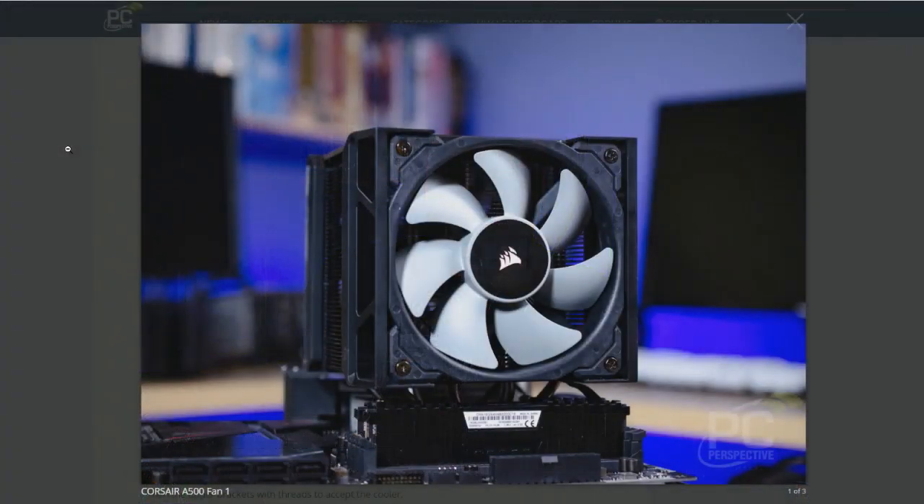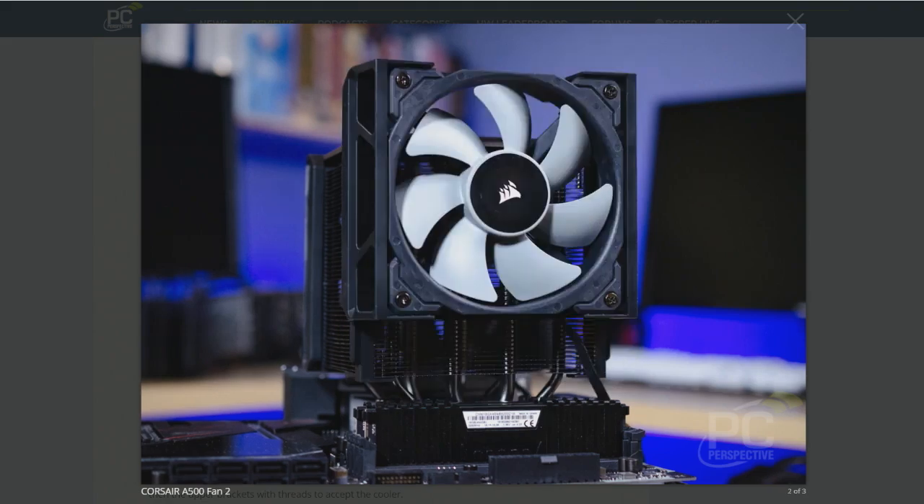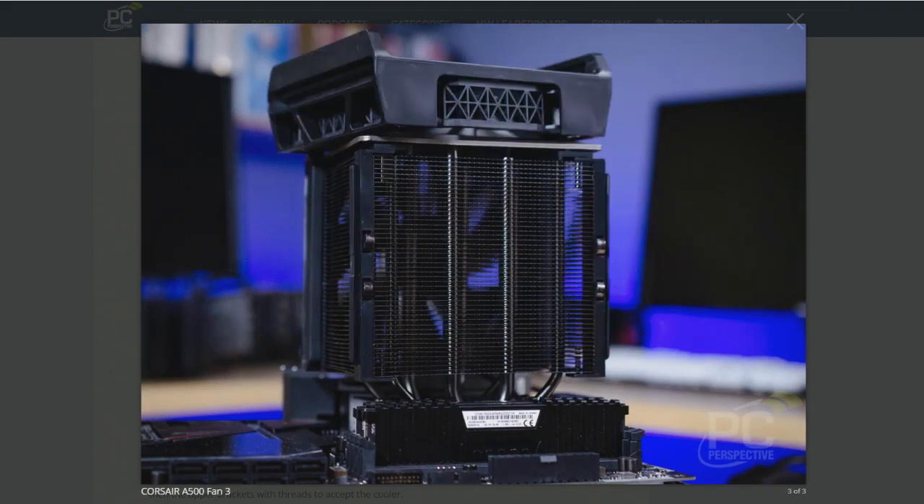When it's mounted up, it doesn't really want to move around — I don't feel like it's making my motherboard sag. Although I would feel a little concerned about using this 24/7 with a budget motherboard. But I don't think you're probably buying a $100 air cooler for a budget motherboard anyway — more expensive motherboards tend to have more layers. So don't use this on a four-layer cheap PCB motherboard, because it's going to make it flex. I do all my testing on an open test bench, so it was horizontal — no problems there. But if I had this inside a case, I'd be a little concerned about a cheap motherboard.